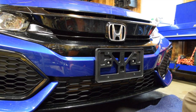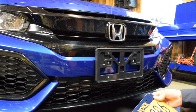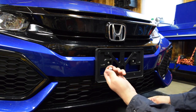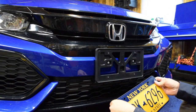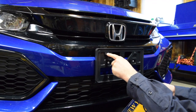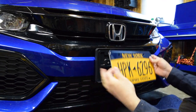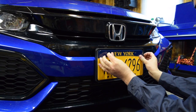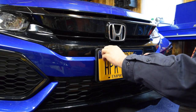That is how you put the front plate bracket on. The last part is pretty easy — like any other car. I'm going to put on my new front plate. They give you four Phillips head screws that also have a 10 millimeter head, so I'm going to use the 10 millimeter. The plate bracket holes come just dimpled, so I went ahead and drilled them out before mounting to make sure the screws thread in nicely.